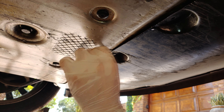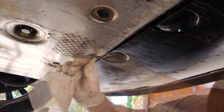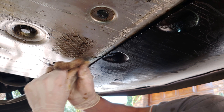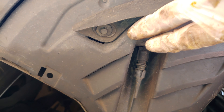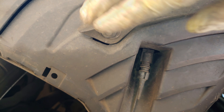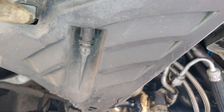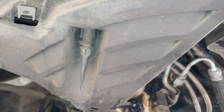Don't worry about the oil — this car's got an oil leak. Quite often these heads break or they get seized in there and you can't open it. You can get replacement push pins — that's the part number there — or use generic ones. In my case this one is seized and you do run the risk of cracking the plastic if you force a screwdriver in, so I recommend putting a hacksaw blade in and just cutting it out because it is just plastic.